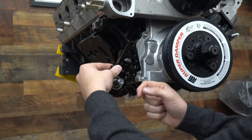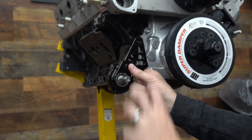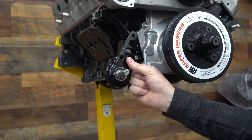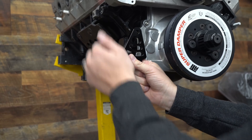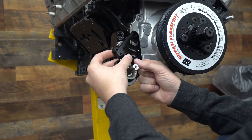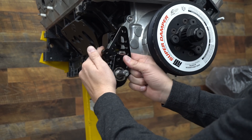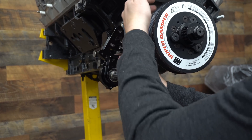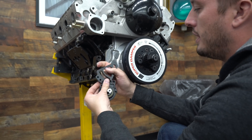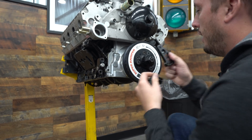You also have a lot of fine-tune ability. This is our LS bracket — spacers will be here — but on the passenger side it lays the bracket out to clear the pulley. If you're too far out near the frame rails because this pulley will be a 56 or 50 tooth on an LS engine to get the correct mechanical pump speed, it might run into the frame rail or get in the way of headers. With these adjustable hole mounts you can move it in, clear your frame rail and headers, and still lay things out exactly how you want.